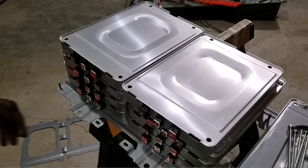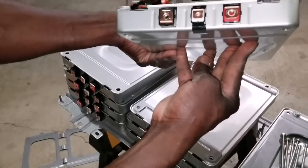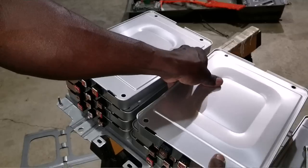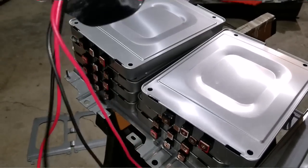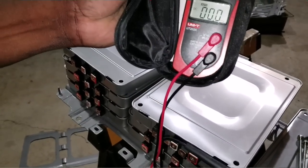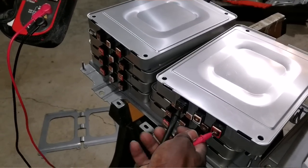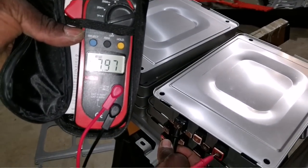Like the stories on the news about lithium batteries catching fire — they've already gotten so much better. Look at all the protection and safety. Folks, don't be afraid to go with lithium — this is the future right here. One pack is about 7.95 volts, something like that — you'll see that in the video. Let me make it easier for you guys. We have the DC voltmeter here, zero it out on DC volt. Stick one probe to the battery — see that voltage? 7.97 volts.